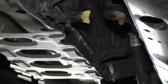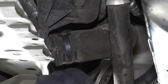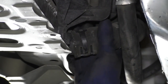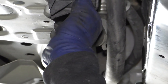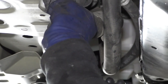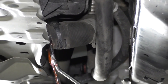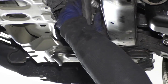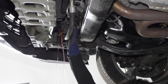That way if I forget when reinstalling the radiator, I don't have any leaks. So now to take the clamp off, just use a pair of pliers and work it up the hose. Make sure you move your bucket over and hope you don't get soaked. I'll have to use my hose release tool — let's work it for a little bit.